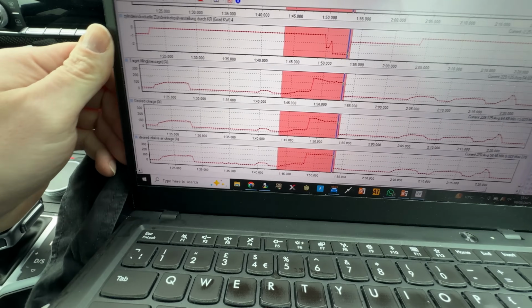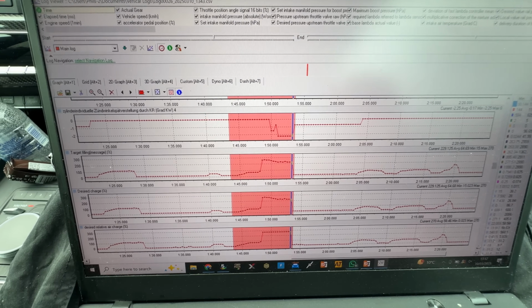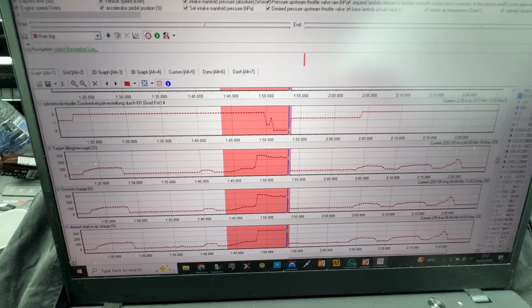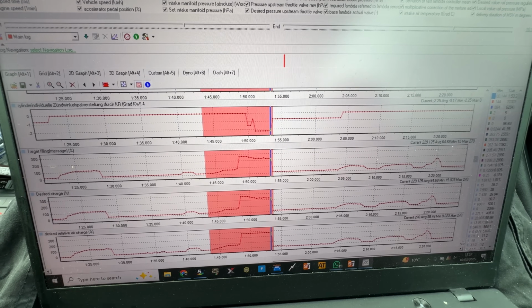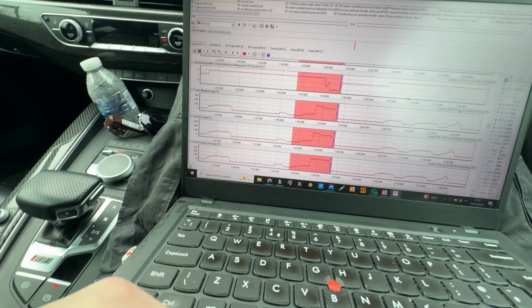It just says no, which makes me think that it could possibly be the turbo sizing on the hot side. And it's getting a bit of extra build-up of pressure that it can't get rid of. Which is a sure sign when you start getting high intake temps and you start getting ignition pull. You can't add any ignition even over stock. It starts to show that.